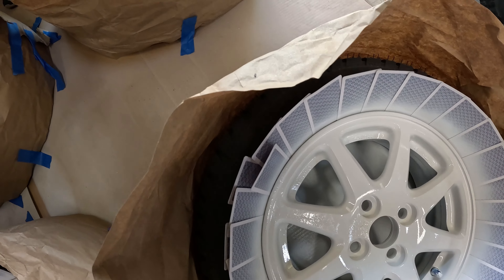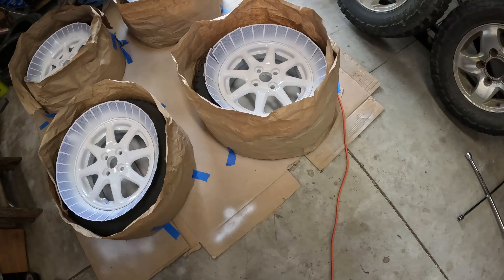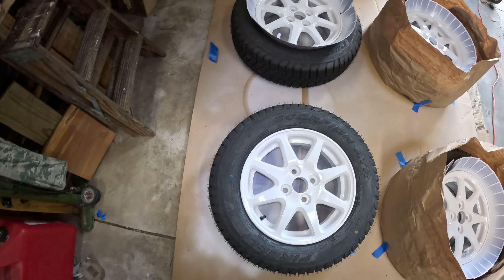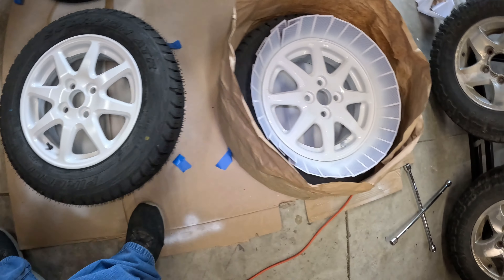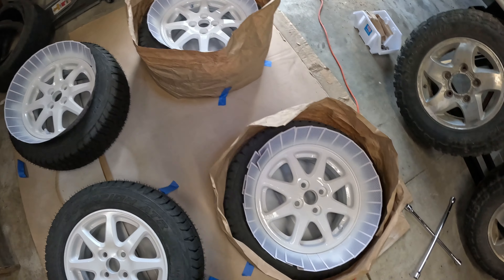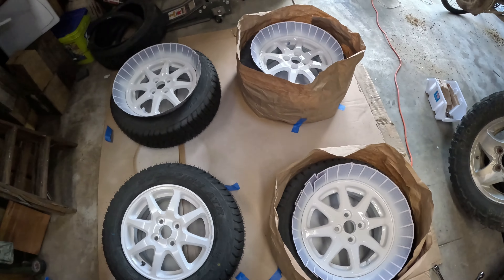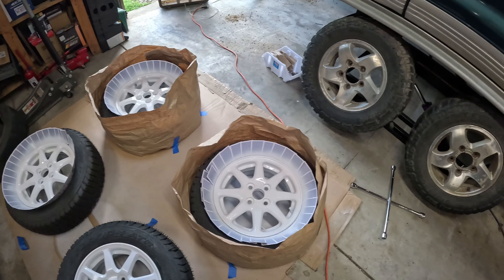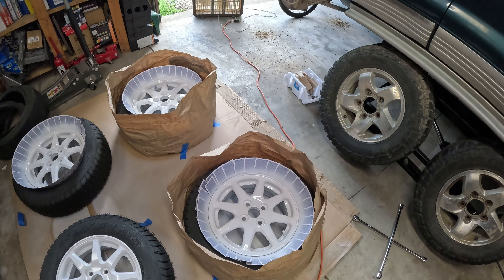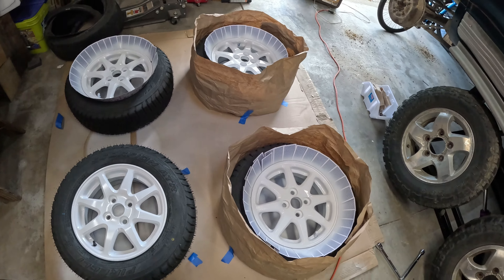Battle of painting with a rattle can — trying to get a nice smooth finish, and sometimes it alligators. Well, the paper and card trick worked — I don't have white tires and they're coming off nice and easy. At least two are done. Those other two I'm going to have to sand again. I know I got it too heavy — I was trying to make for a nice smooth finish but just got it too heavy, plus the problem with starting with the other can. The first little bit that comes out has a little more solvent in it, so I should have just sprayed off the first bit somewhere else and then started using it.